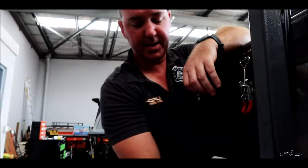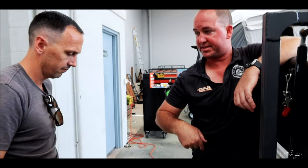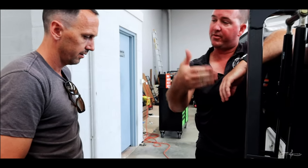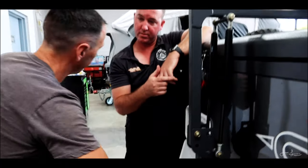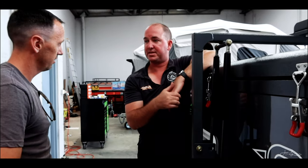So whatever you plug into here, you're going to get here. So if you want hot water over the kitchen, cold water comes out of here, runs into there, pushes straight over the other side of the camper trailer, and then you'll have hot water. So if that comes from pump one out this one, you loop back around, you pressurize the whole system? No. You're just running it straight back across the camper trailer.